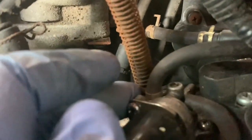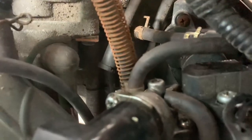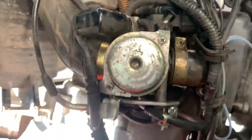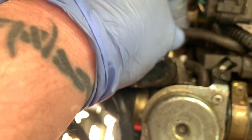There's a little clip — can you see it? We're going to pull that off and do the same thing, block them two off. That's the carb part of it de-restricted as much as you can. Then put that one back on — and that one is back on and clicked on properly.